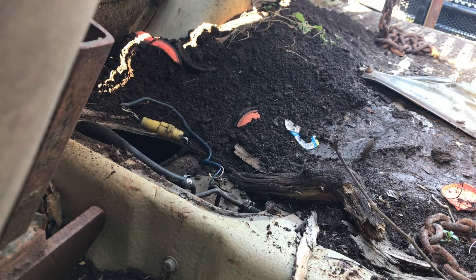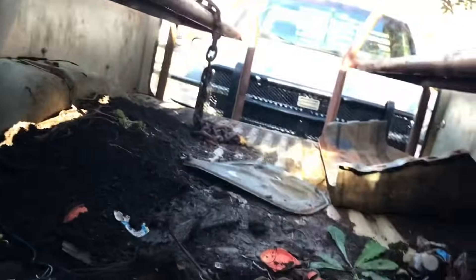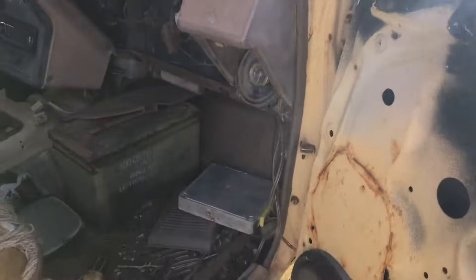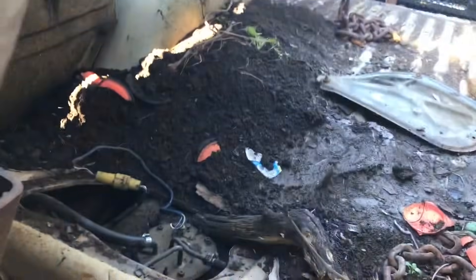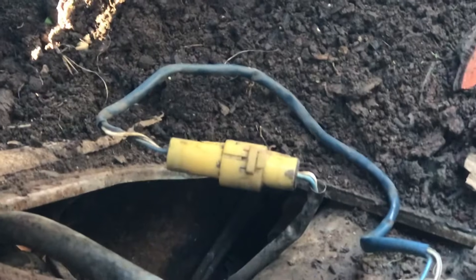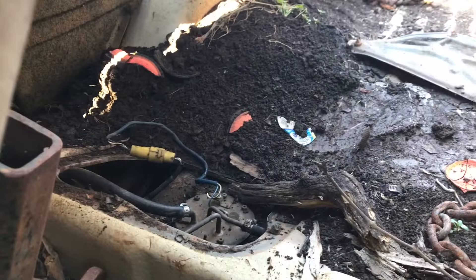What's up YouTube? Just a quick little video on something to check if your 22RE's fuel pump is not getting power. Once I got this 22RE in this abused 85 4Runner cranking, I then wondered why I wasn't getting fuel. So I checked the power at the fuel pump, which is super easy. You unplug that and then check those two wires while cranking — if they aren't getting battery voltage, you'll have a problem.